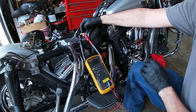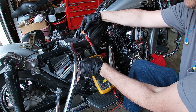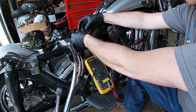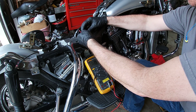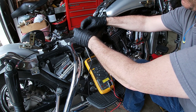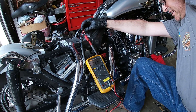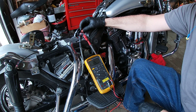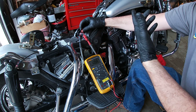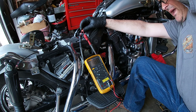The other thing that you want to do is check that you have 12 volts. The way to do that is you go from the red with the plus wire and the black with your ground wire. Just plug them in, then get a regular voltmeter set to DC volts, turn the power on on the motorcycle, and it comes up to 10 and a half volts. That's what that speedometer puts out, so I have power down here.